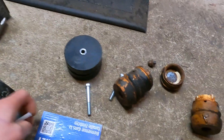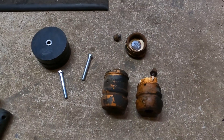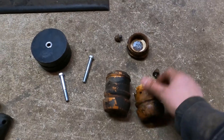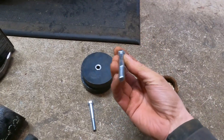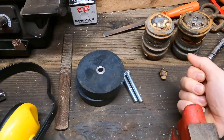You get your Timbrens sticker — welcome to the family! It would be easier to take the tires off. It took me a couple hours to do this, but it really wasn't that hard. The hardest part was just getting the old ones off. I do like this style that bolts on — I've seen other videos where it's just a friction fit, and I like the idea of having the bolt so you know you're never going to lose it. I'm going to save the spacers and if I end up thinking I need them after a few loads, I might put them on. Pretty simple product to install and pretty simple in the way it works — really no maintenance to them, you just put them on and they do the job. I hope the video helped you out. I've got lots of other DIY videos, so hit that subscribe and you'll know when my other ones come up. Thanks for watching everyone, see you next time.